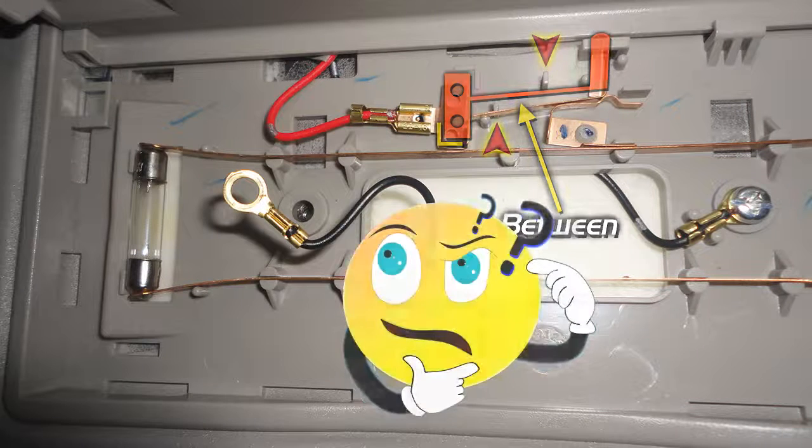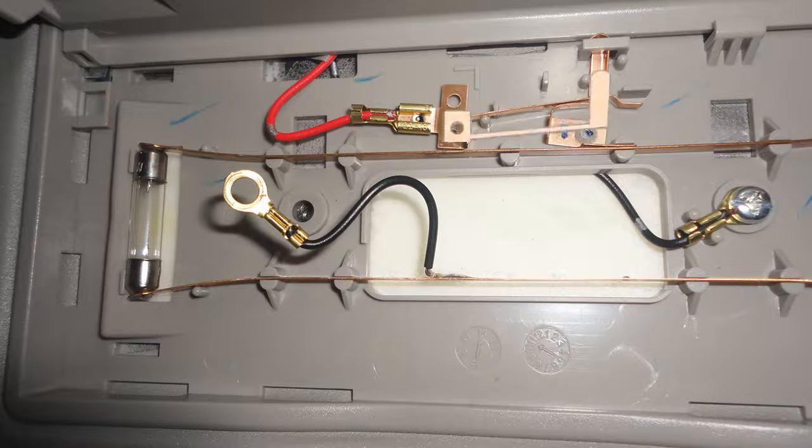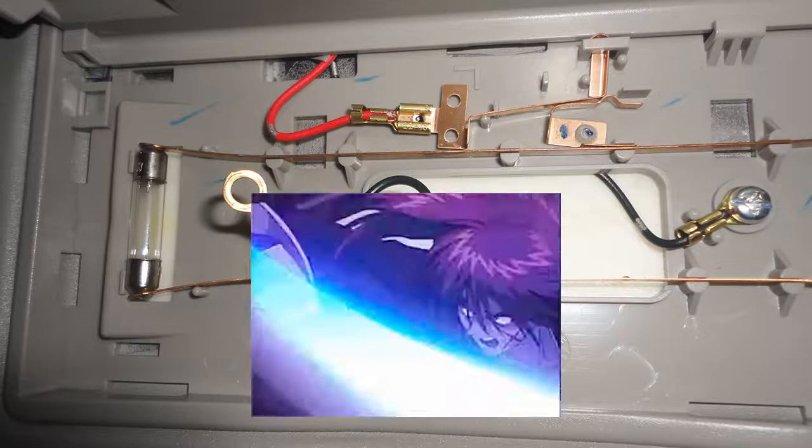Now you ask, how the heck did it move down there? The switch is held by round pins, similar to this one. However, they are not strong enough to tolerate the forces exerted by the mere repeated action of opening and closing the cover. My Rush is less than 2 months old, and the round pins are already MIA. They were sliced clean off by the switch itself.